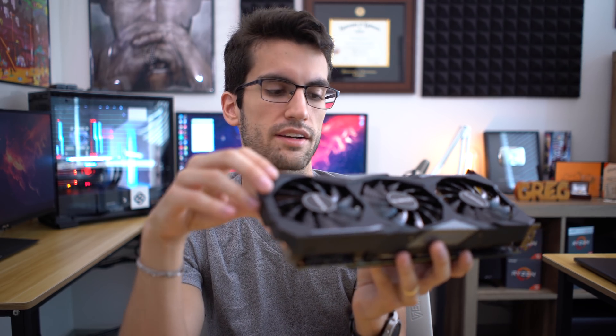I think we're going to realize very quickly why this isn't such a good idea. Not that it's a bad idea, but I will have to double check and make sure that the cooler Gigabyte is using for this card is not aluminum. The liquid metal we're going to use in today's video reacts with aluminum. It's actually the same liquid metal we used when we delidded our i9 CPU. But because of that concern, I want to make sure this cooler doesn't have any aluminum contacting the GPU die directly.